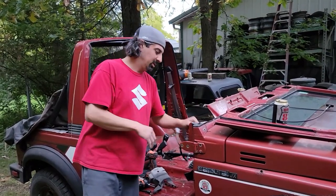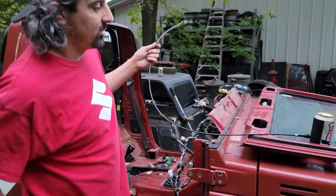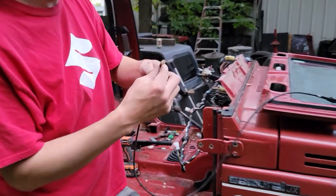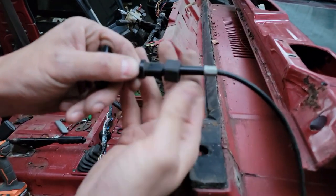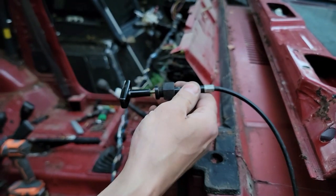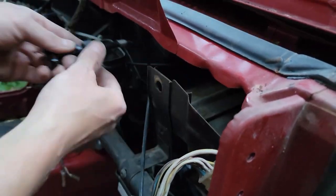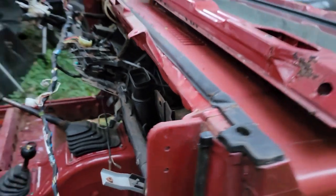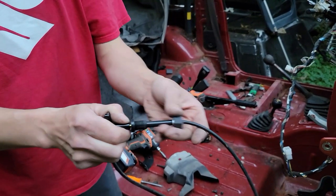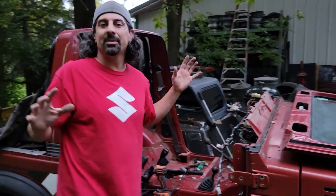You got all your wiring here, you can disconnect it. Now there was a little plastic piece — this is what you're doing behind the dashboard that, unless you've done it before, you don't know what you're looking for. Behind the dashboard in the back of the glove box, this plastic nut threads into here — this holds the glove box tight to the firewall. There's a metal bracket sandwiched in between, and that's why you can't move anything. I was reaching back and working this plastic nut with my fingers. Spin it off, then you can pull your cable through — this is the other end that hooks to your hood latch. Pull that out and then you can pull the dashboard out.